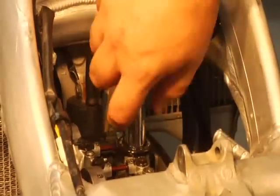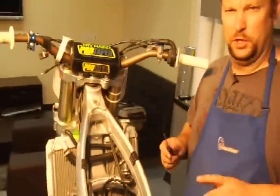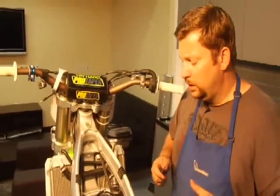Alright, so another good trick is to take the spark plug out. I've learned that over the years. Take as well the spark plug cap rubber dampener out. Now we got to find top dead center. It's always a place to start and finish when you're installing a new top end.